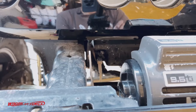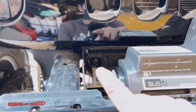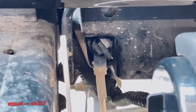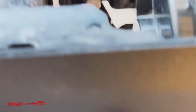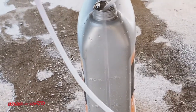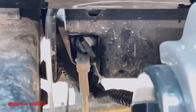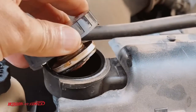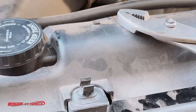Let's get started. The access to the drain plug is right here on the lower part of the radiator on the passenger side. It's basically a little on/off valve and I've got a hose connected to that valve coming down into a jug right here. Once that's done draining we'll go to the next step, but while you're doing that it's important to come up here and loosen the filler cap so you let air in and it'll drain a little faster.